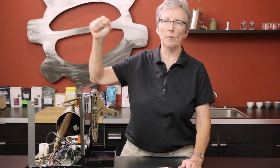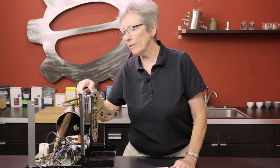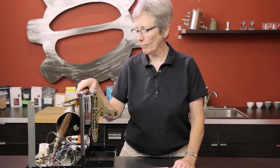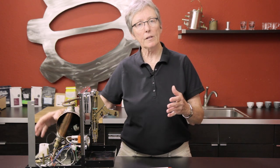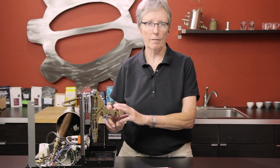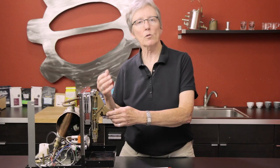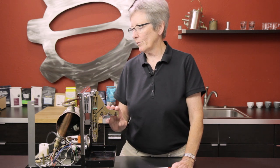How he did it was a lever machine — you just pull the lever down and you were the source of the bars of pressure. Moving forward, they started coming out with electric pumps, and what they figured out is how it all equates: a 15-bar pump is what's needed. By the time it goes through all the workings and gets up to the brew head, that's when you're going to get your nine to ten bars of pressure on the coffee — along with the temperature.